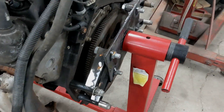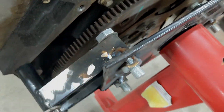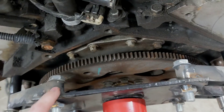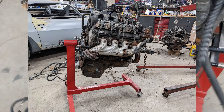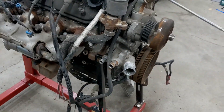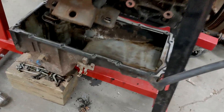If you've been watching the channel, you might recognize this is the engine stand that tried to kill me. I did some welding on here — this only fits the Chevy bolt pattern now. I was hoping that would help keep this thing from being so flimsy. What I found is that this plate right here is really what bends, and that was bad again, obviously. So I put these struts on here like I had before and that helps hold up the weight. This kind of sucks with an engine stand that's too flimsy to flip it over.